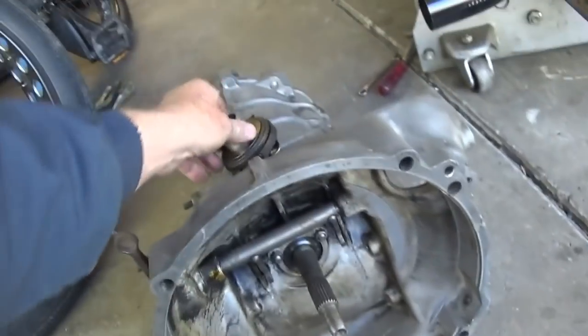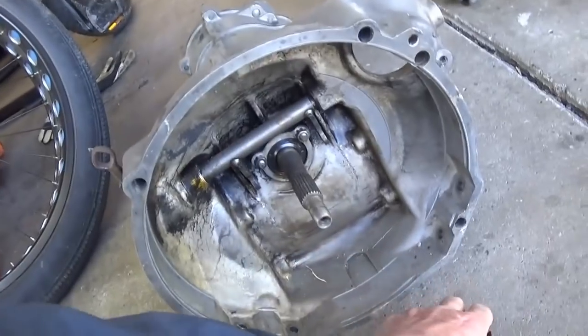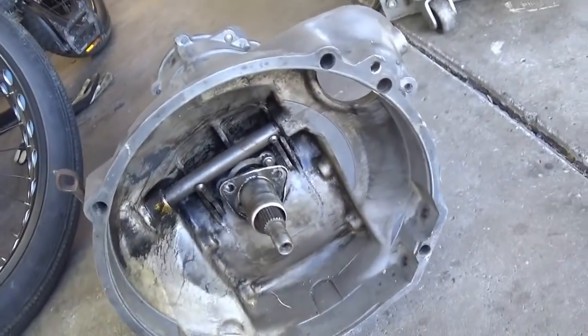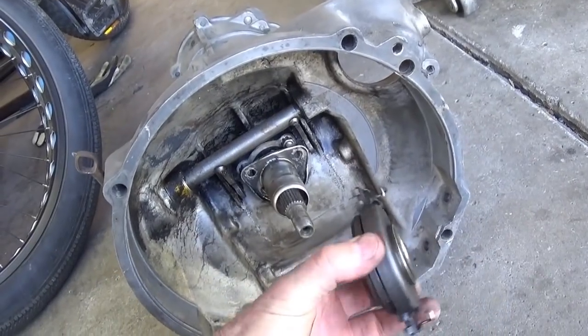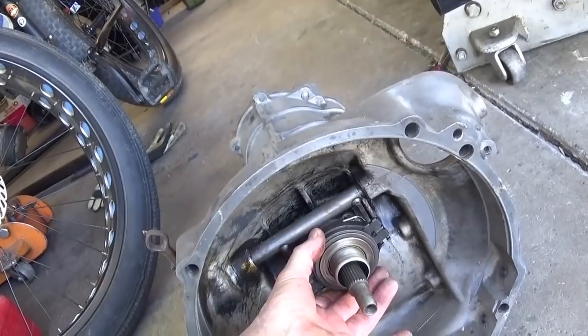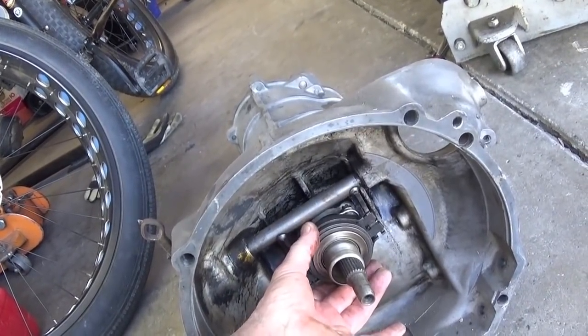But the stock setup wasn't perfect either. Even today, as they manufacture cars, you go by any car dealership and the service department's always busy. Here's the difference. You'll see that it's got the three bolts over here, and what that does is holds this sleeve in place, and then your throwout bearing goes on here, and that sleeve helps keep that throwout bearing centered, and that will prevent that wear on the Kennedy clutch.